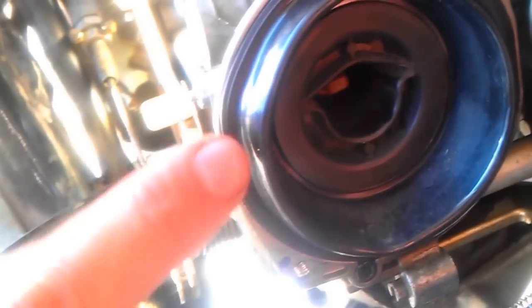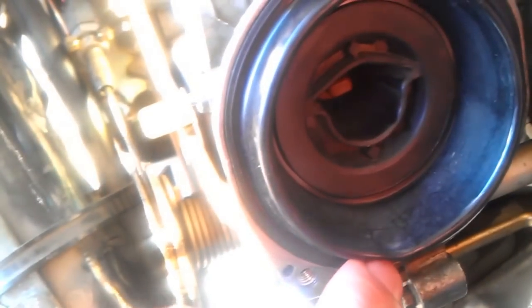It slides in gently on its own just like that. Then make sure the diaphragm is back inside its mounting area — be careful of the o-ring down in the bottom of the carburetor, and make sure the diaphragm is fully inside the lip that it rests in all the way around. Once that's done, we're ready to put the cap with the spring back on and move on to the next carburetor.